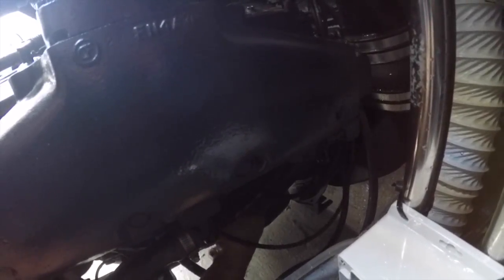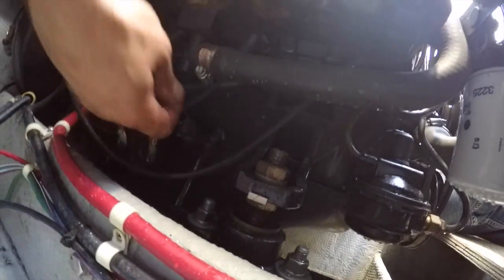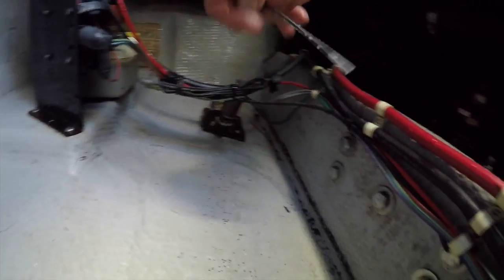When you bring a boat this size to a marina, they charge. That one there is barely draining, it's just trickling. For that, you definitely want to get your little poking stick. I'm just using the inside of a pen because I didn't have anything there, and it was poke, poke, poke, and there it goes. See the difference, how much that's flowing. That's what you want. You want it to pour out completely and not get plugged up with sediment. This one's still draining quite a bit of water. And you can see the rust that came out of there, dirtying up my bilges all over again.